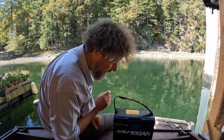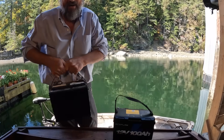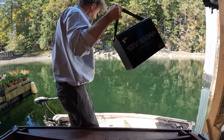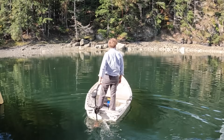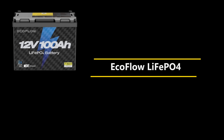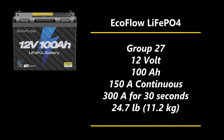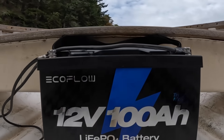Let's get into some real-world testing and get this thing in the dinghy. First off, out comes the beastly lead-acid battery, to be replaced — painless. The battery is in the Group 27 form factor at 12 volts and 100 amp hour capacity. I must say it's been an absolute joy these last few days zipping around the bay with this little battery, never having to worry about if it'll go flat.